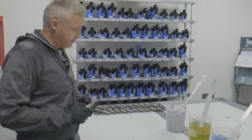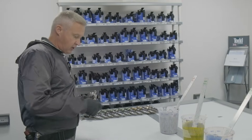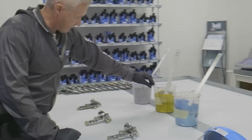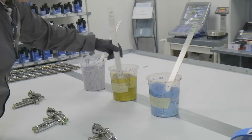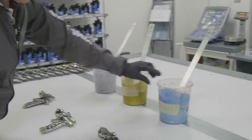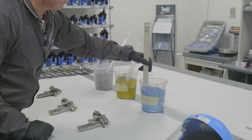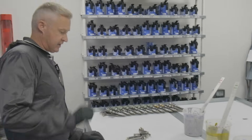This is what is required on your wet-on-wet primers — the flatter the better, because everything lays on top of that: your base coat and clear coat. Moving on to base coats, we're going to be using two colours. We're going to use Mustang Olive, which is a Ford colour — quite a striking colour — and then Aquamarine, which is a metallic blue. Quite an old colour but it's good for doing smart repairs, which is the nature of this.